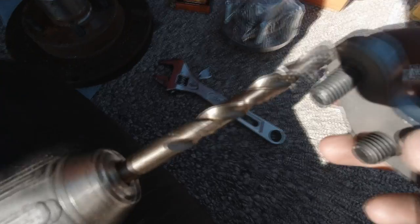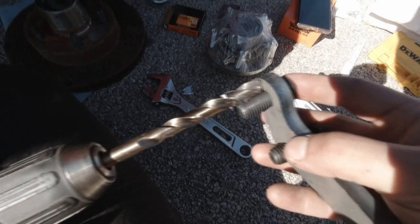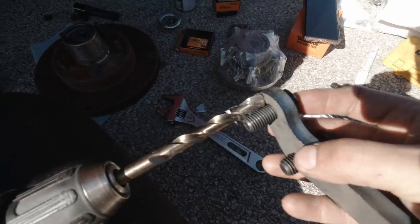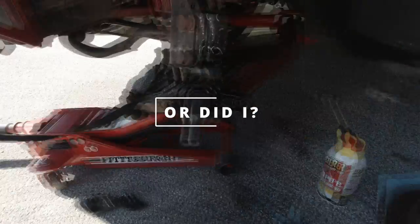We drilled the top hole — no problems after the step-up, it was much smoother. There's our white tick mark, and just so you guys can see, we still have about an eighth inch of space before we would bottom out, so we've drilled far enough in. Now we're going to get the right tap out. I got my tap and die set right here.